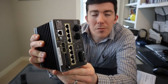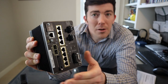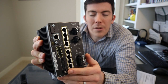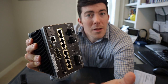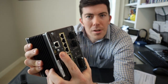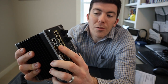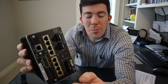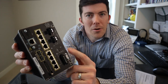That's everything in the box. Let's look closer at the switch itself. There are a number of different connectors on here. This is the eight-port variety — there are a handful of different options available from Cisco. You see the eight ports down the middle, typical Ethernet interfaces. We have a pair of USB-A connectors under this cover, for plugging in a thumb drive if you need to load software or a configuration to the device. There's a typical console port, and a USB console port right under it for connecting a modern USB console cable for initial configuration. There is also a pair of fiber SFP module slots — you can put single-mode or multi-mode fiber modules in there. There are rugged SFPs as well that handle higher temperatures, which are a good bet to go along with this device.